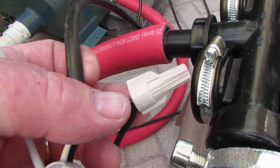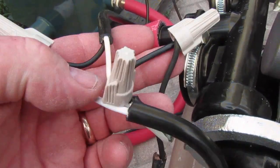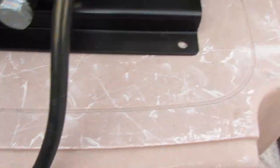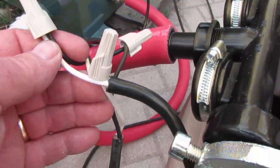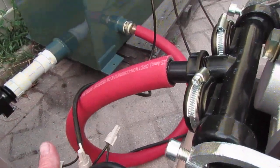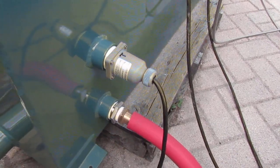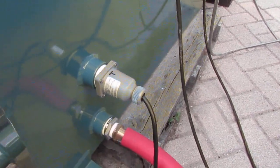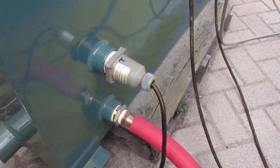Your negatives are already connected for your bison motor, which comes originally from your machine's chassis ground. Then the 12 volts is actuated on this line here, and that's what turns on this bison motor. It's a pretty simple setup, and we get the switches way cheaper than John Don. We do the wires and everything and hook it all up to make it ready for you to be able to use it.